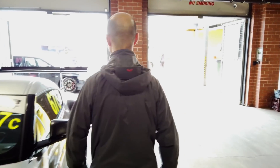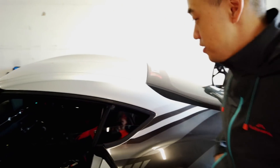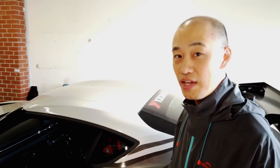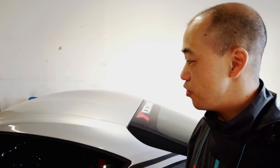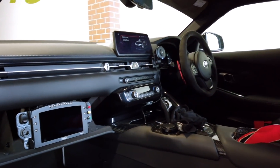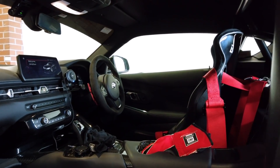We've also got quite a neat little logging setup in this car. Yep, so if you look around here, we've integrated a Motec display and it is logging shock pot data from all four corners of the vehicle. That's basically telling us what each wheel is doing, how each damper is performing, how the aero is working, and all that stuff — so we don't have to guess anything.